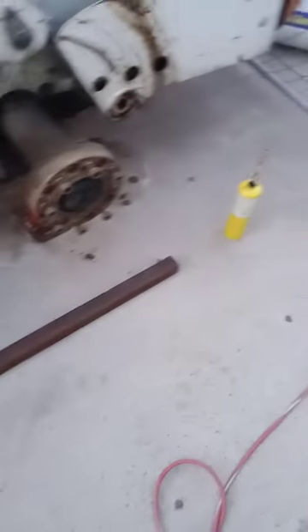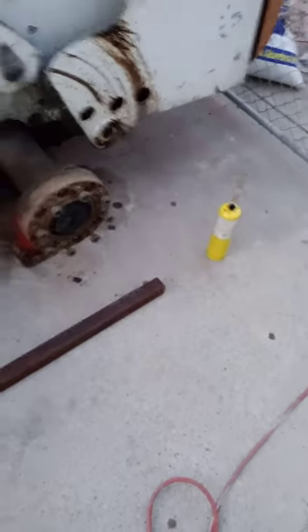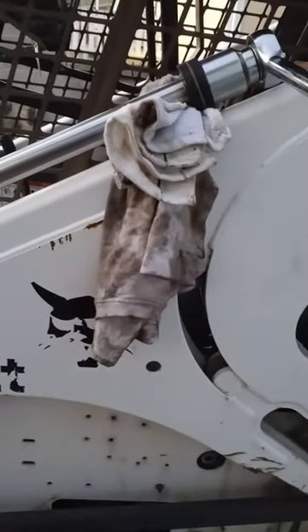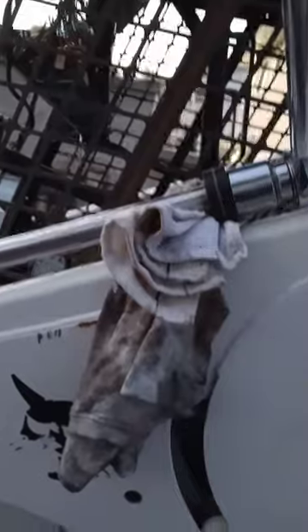I was using a breaker bar with those two pieces of metal, and I hit it with some heat — probably two or three minutes with that torch right on that nut and thread area, kind of where they meet. I didn't think it was gonna work but I got it loose, and it's coming off. It's definitely on there but it's definitely coming a lot easier.